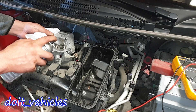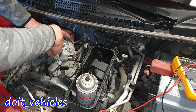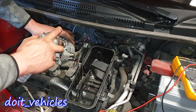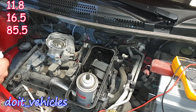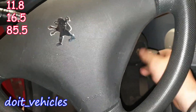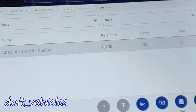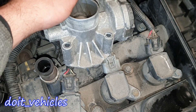A lot of you have told me that you should not press on the throttle body flap because it will mess with the calibration. But I'm going to show you the live data after I clean it, and you're going to see that it's going to be the same. I pressed it all the way to 85.5%, then released it and it reads 11.8%.